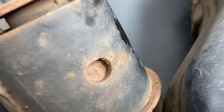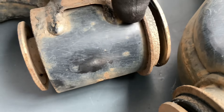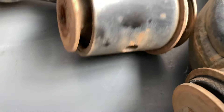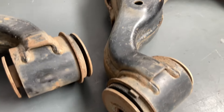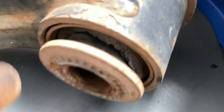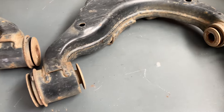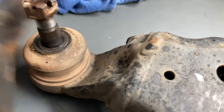It's actually hard to get in there and see the cracks — you can even get the part number there. They get really stuck in there. See that rust in that hole — these holes that you punch out all fill up with dirt and rust. When you press the bush in, it's an interference fit — estimating eight or ten mil up this end where it goes in, and the rest isn't as tight. The bushes are off their heads. What I wanted to show you is those adjusters — there's a big bush and a small bush; the small one at the front of the big adjuster gets seized. This one's already completely gone. We'll keep these arms because they're original genuines, and we're working on a system to change these bushes. You can't buy genuine ball joints separately — the only way to get one is an arm.